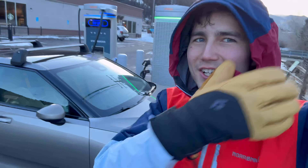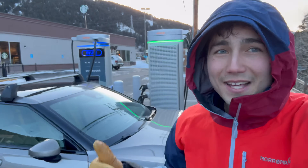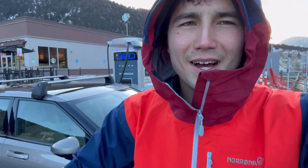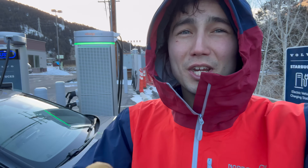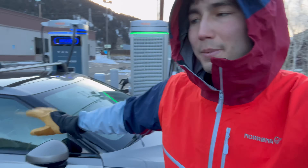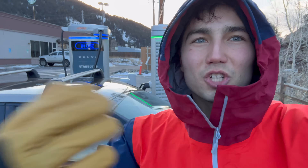Found the chargers — they're actually 62 kilowatts by design, not 200. Perfectly fine if you're going to go into Starbucks and get a drink. To summarize: one, start off with battery conditioning at home on cold days, whether commuting or taking a long journey. Two, if you're taking a long journey and your car has battery preconditioning or built-in navigation, select that charger in your car's navigation so the battery is warm and can charge quickly.